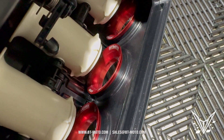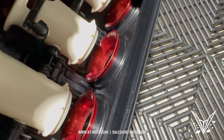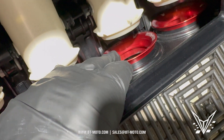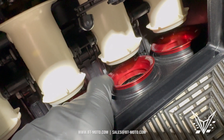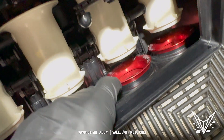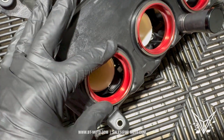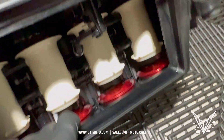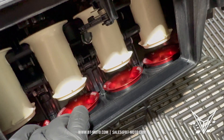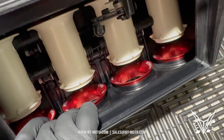A little bit of misting is fine, but if it's dripping and there's a puddle in the airbox, that's a problem. People are complaining because our stacks aren't a complete seal against the airbox — there's a little bit of leeway. Our stacks are perfectly round, but sometimes the hole that BMW created in the airbox is out of round, meaning it's not a perfect circle. So you can see some stacks are a little bit loose. If you're seeing oil leak from the velocity stack, it's not the stack's fault — your motor is projecting oil and it shouldn't be doing that in the first place.